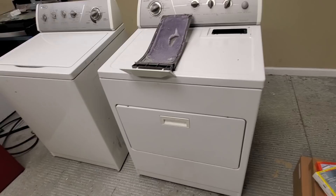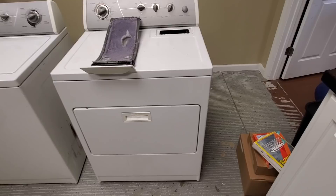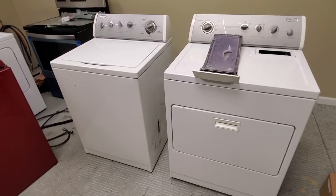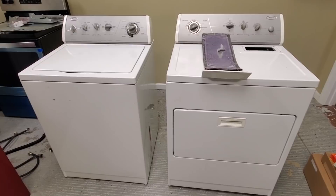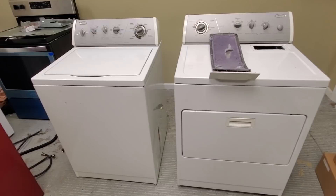So these are the appliances I suggest you buy: the Whirlpool direct drive washing machines and, if you can, the Whirlpool dryers. Dryers don't have much that can go wrong — they're pretty easy and cheap to fix. The technology on dryers hasn't changed too much, so just make sure you stay away from anything electronic. Stay away from front loaders on washing machines — I don't care how good they look. When you try to sell them as resale, the parts and repairs will cause what you call price compression, where it costs about as much as a new washing machine to fix them.